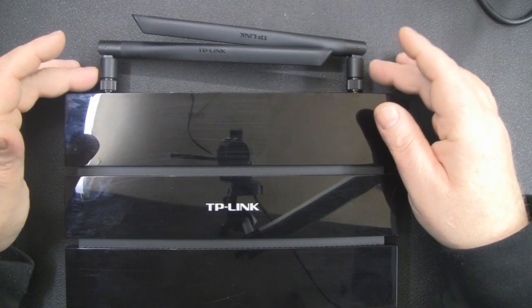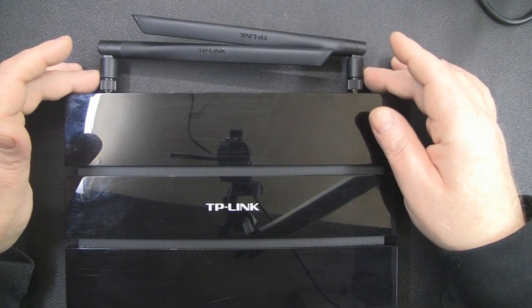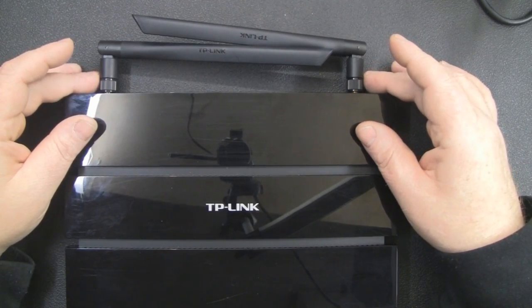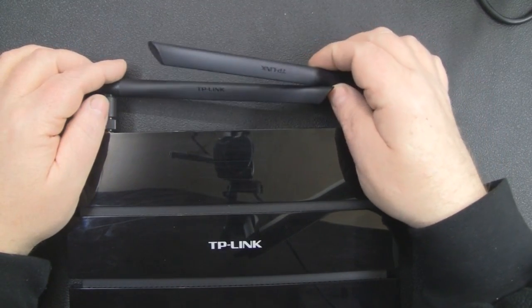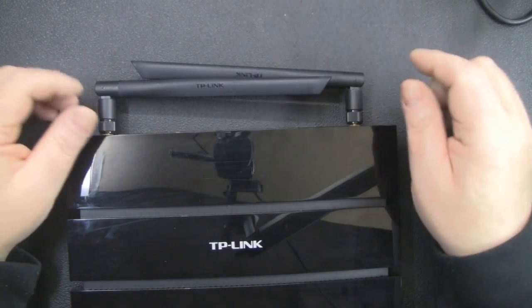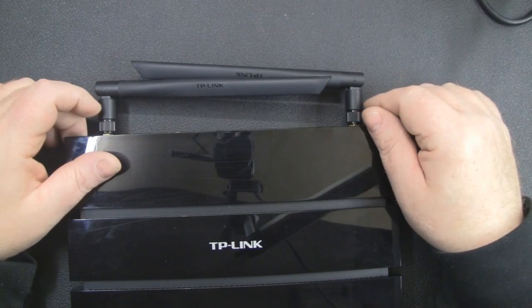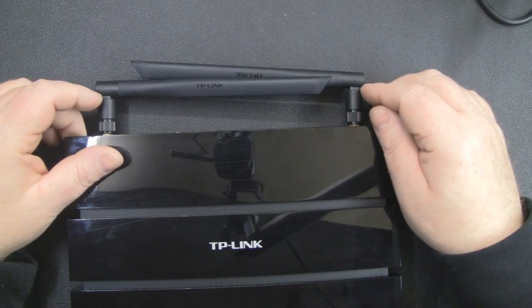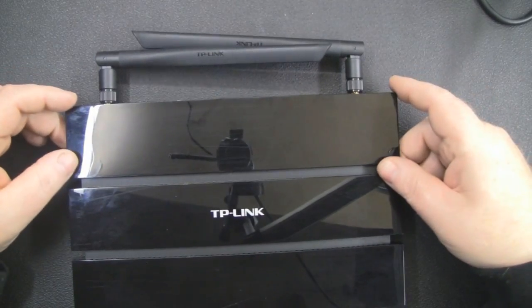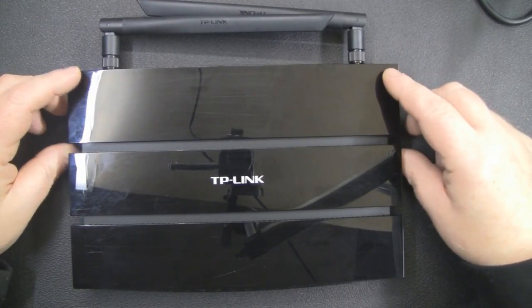I'm not really a big fan of dual-band antennas — you can get some really good ones that work well, but they tend to be extremely expensive. These kind of antennas are an OK 2.4GHz and an OK 5GHz, never really a good antenna. It's a bit like that old saying, a jack-of-all-trades and a master of none. But this router will also run some custom firmware, OpenWRT.